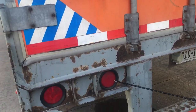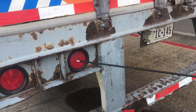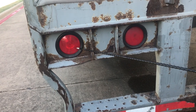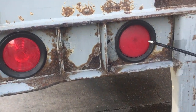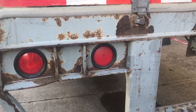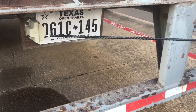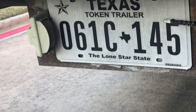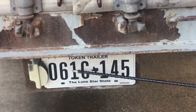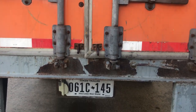Here you have your brake lights — you will check the left side and the right side. This is your brake light and running light, here is your turn signal, and your running light. Make sure the rubber seals have no abrasion, bumps, cuts, or dry rot, and that the lens is not cracked, bent, or broken on both right and left sides. Here you have your license plate light — make sure it's clear in color, properly mounted and secured, not cracked, bent, or broken. Check your license plate — make sure all nuts and bolts are properly secured, it's not damaged, it's current and up to date, clean, and visible for DOT purposes. That concludes this section of the pre-trip inspection on your trailer.